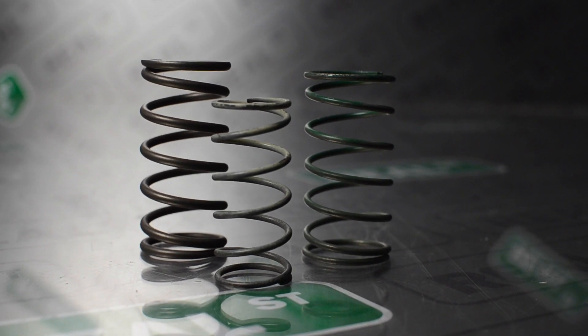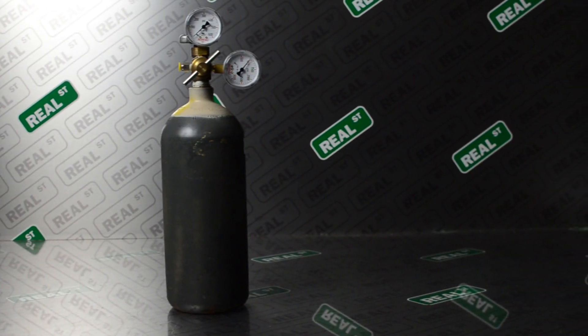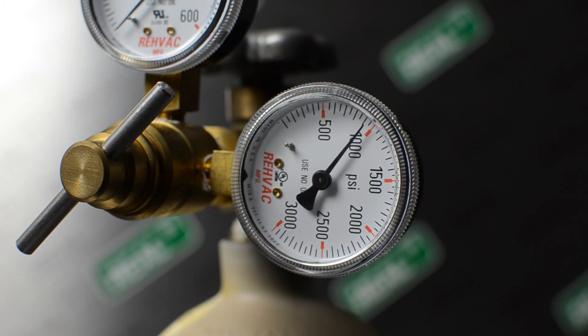So there are a few different ways to use your 10 PSI base spring to reach your 40 PSI target. A lot of drag racers will use a CO2 bottle, using an artificially high amount of pressure to pin the gate shut. So if you have a 10 PSI base spring and you put 50 PSI of pressure on top of the wastegate, the wastegate will stay shut and you'll be able to achieve your target. You can also use two three-port wastegate solenoids and only run the second solenoid in the higher gears. Most advanced standalones will allow you to create maps where you can only run the second solenoid in the higher gears or whenever you desire.